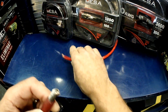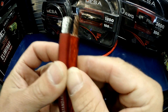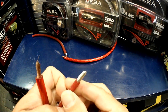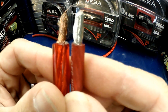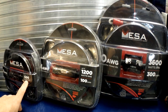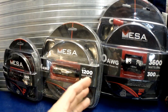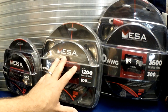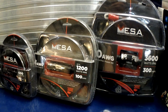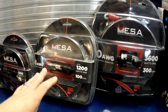You want to get what you pay for. Here's actually a different one — this is supposed to be 4 gauge as well, which is ridiculously different than our actual 4 gauge kits we carry. It's actually even still a little bit smaller than our 8 gauge kits. So if you take a look at our amp kits: this is an 8 gauge kit, rated at up to 600 watts RMS based on its full length. 1200 watts for a 4 gauge kit, and 3600 on a 0 gauge kit — once again based on the full length. Now since this is based on roughly 17 feet of full length, if you went under the seat and only used like 9 feet, theoretically you could get away with a smaller kit — but I still don't recommend it.